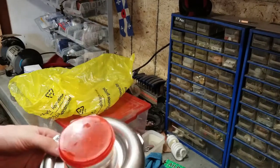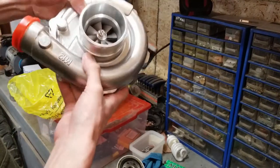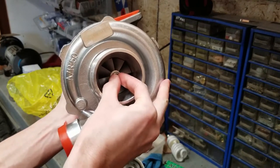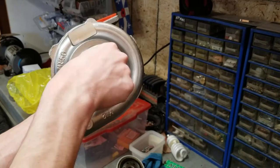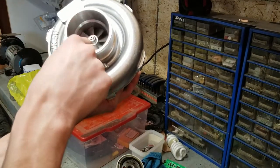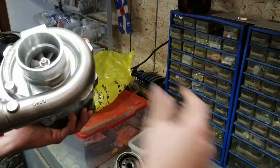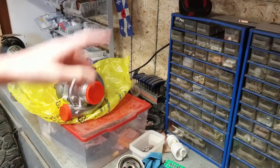That is the exhaust side — I don't really want to get my greasy fingers on everything. That's the money shot right there — oh yeah, turbo! No play at all, same as before, tiniest movement. Spins free. Take a look at all those fins, make sure everything looks proper, if it's damaged or immediately concerning. All right, let's wash my hands, we'll get that in the car.